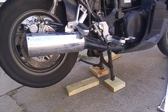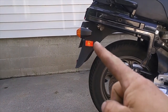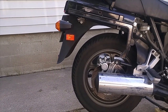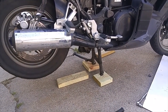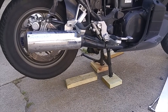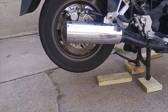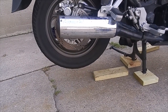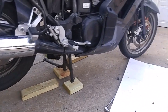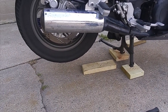I'm going to try that so I don't damage the exhaust, and honestly one bolt sounds easier than removing both exhaust pipes. Another thing is that people can either cut some of the fender down — like 4 to 5 inches is what I read on that forum — or if you get the bike up on blocks like this, you roll it up on 2x front and back. I would use a 2x6 or 2x8 because it was a little perilous and I slipped off on the front wheel a couple of times trying to get it done.